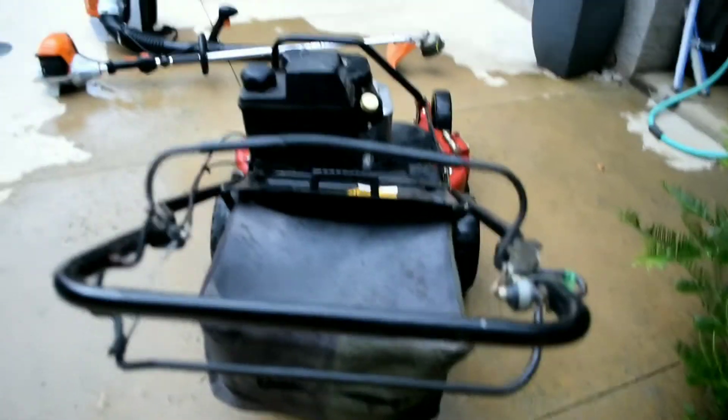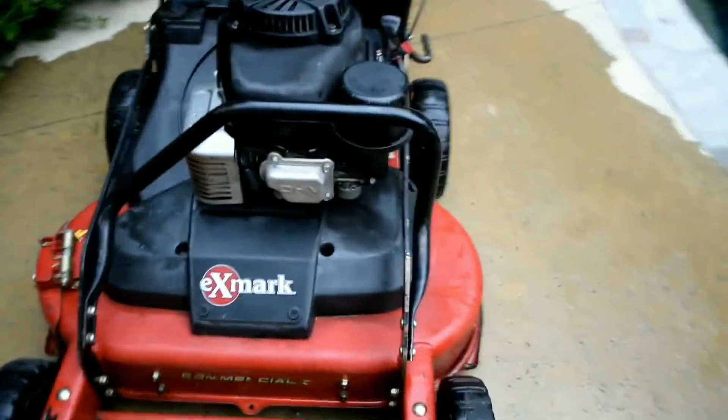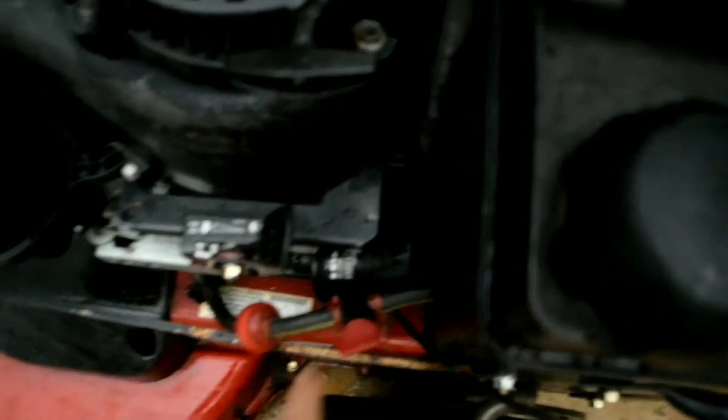With this one, it actually doesn't turn off unless you actually bring a lever down. This is how you turn the blades on — you press down this little piece, it's harder to do one-handed, and you bring down the top lever and your blades will turn on. It will still stay on if you let go of that, so then you can just bring this up to go forwards. You've got your one-gallon fuel tank, which is really helpful — I don't have to carry gas around with me anymore. You've got your air filter, which is a pretty beefy air filter; it really does a good job. And then you've got just some support around the mower to give it structure.